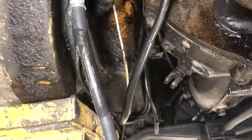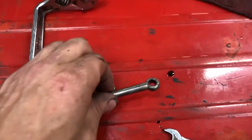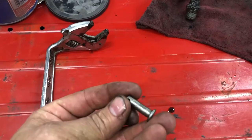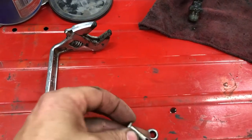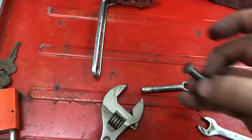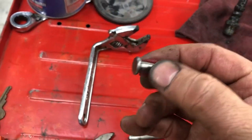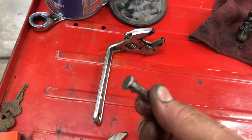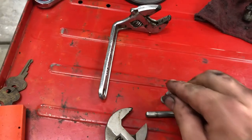In this case the rod and the clevis isn't terribly worn — there's not that much wear in it, so I'm just going to reuse them. A little bit of grease on there to get lubrication so that it moves smoothly and doesn't wear too quickly.